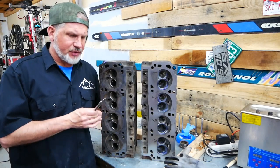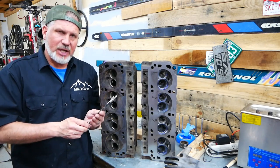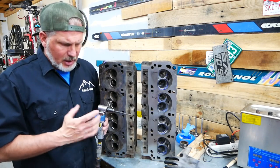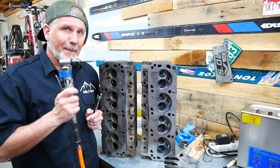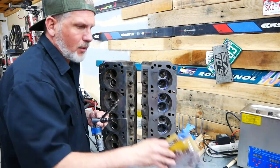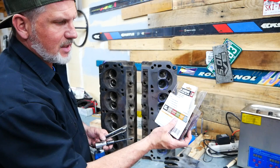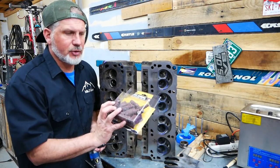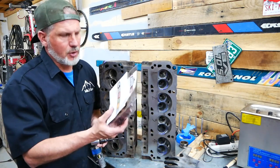As far as the tools I used, it's real simple. I bought a $50 burr set off Amazon — they're long shaft burrs that I'm using with an angled die grinder. A lot of videos will tell you to use small straight die grinders, which is probably true, but I had this and it actually worked amazingly well. It's already got the paper roll die on it. The paper rolls I use are from Harbor Freight — cone shape and rolled sanding discs ranging from 40 to 60 up to 320 for fine. I primarily used the 80 and 100 grit versions, though I tried a 40 a couple of times, but a burr works better than the 40 does.